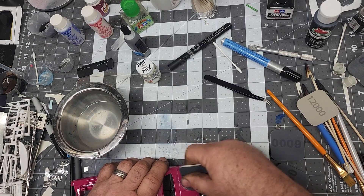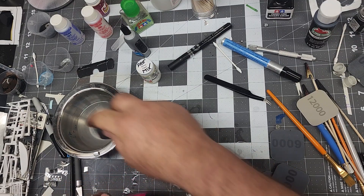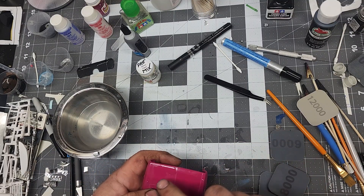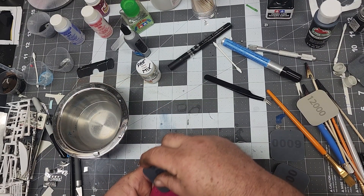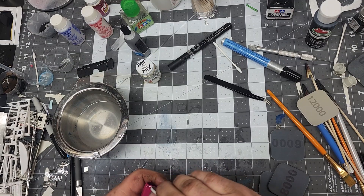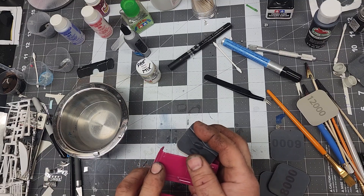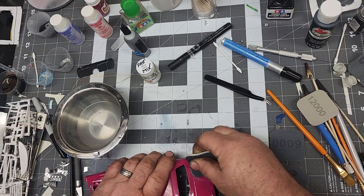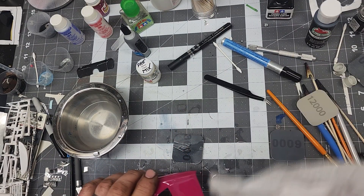When I was painting this I saw the spots and thought I'd layer it on, because you don't want the paint too thin — you need something to sand. Whether it's clear coat or paint, make sure you have good coverage before wet sanding. I've got to watch my corners because it looks a little thin there. If it goes too thin, it goes back to the booth. A microfiber towel works best for wiping it off.